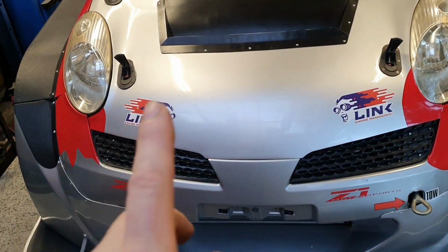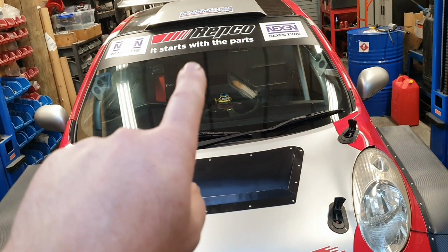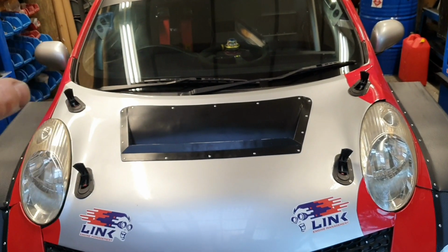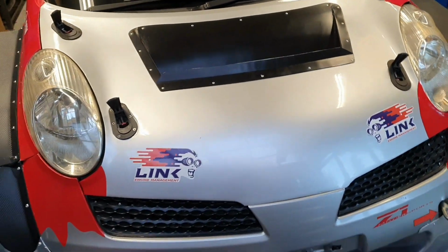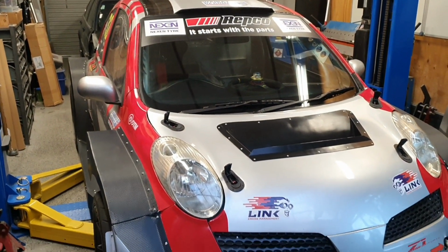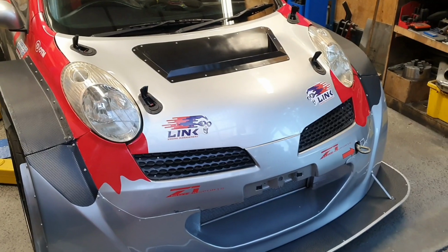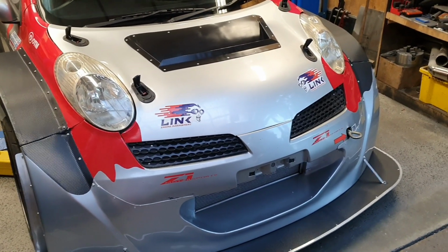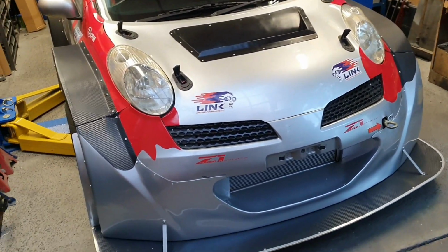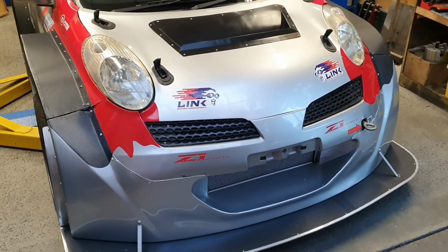So I've changed some of the settings for the water pump that's living in the front here, the electric booster pump that helps the main mechanical water pump on the engine, because that doesn't keep up very nicely with the long water track on this vehicle. Once you're on the track, it was okay. We found this all out while it was 2-wheel drive, but at lower engine speeds, the water pump just doesn't generate enough flow, positive and negative pressure potential difference or whatever, to get the water all the way from the back to the front and back again at adequate speed, and it tends to run a bit hot. So we have an electric booster pump, and I've changed some of the settings on that to help us out.